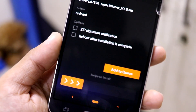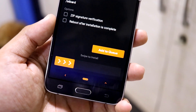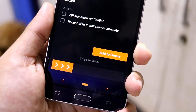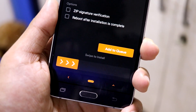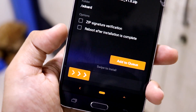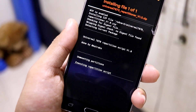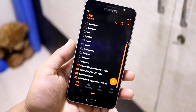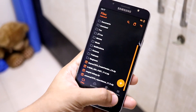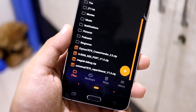The default repartitioner sets the system partition to 4 GB and also increases the cache, which is required for the ROM. Before flashing this repartitioner, back up all of your internal storage. There's a disclaimer — use it at your own risk. There's no actual risk if you have the PIT file saved. I'll also post the PIT file, which you can flash through Odin to restore the default partition size of your J7 2016. Flash the repartitioner zip and wait a few seconds or minutes — it will show successful and automatically boot back to recovery.